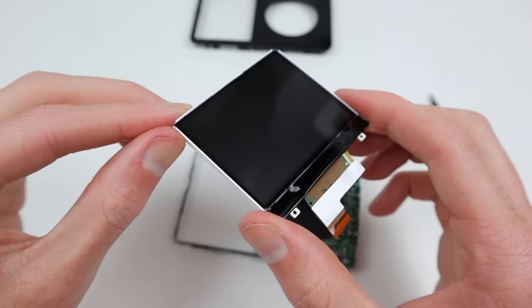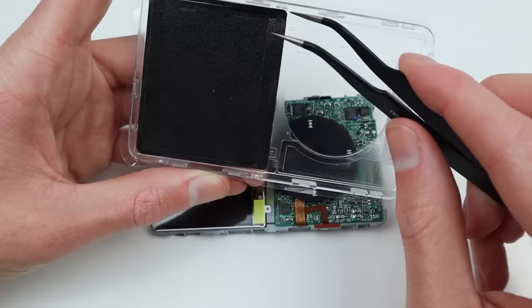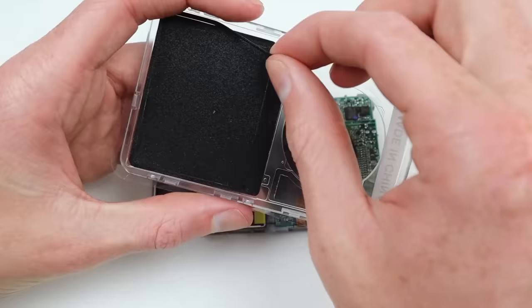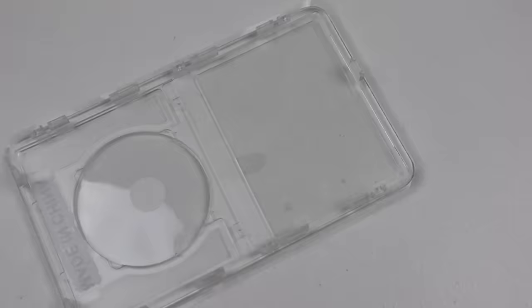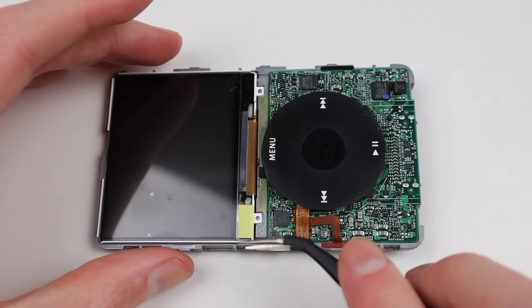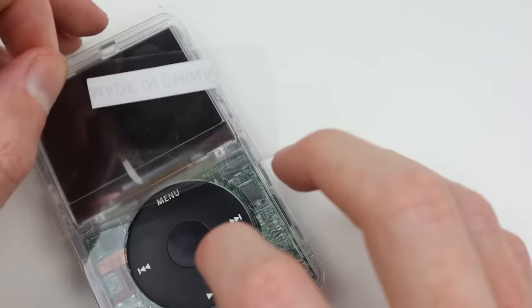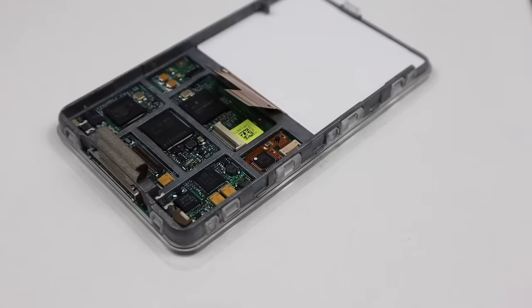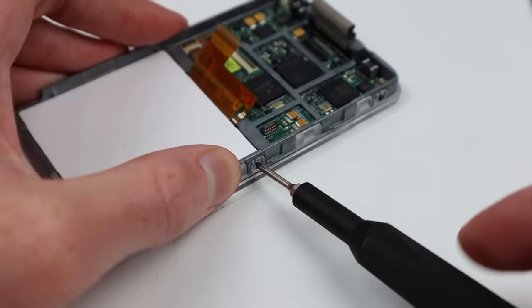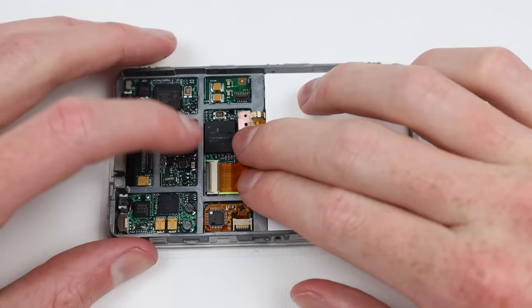I'm a big fan of custom devices, so I thought it's about time I customized one of these old iPod Classics — one of the best tech devices of the early 2000s. I've removed the faulty LCD display and can now prep everything for the new transparent housing. I'll install a new display purchased for around $20 off AliExpress — likely off a used iPod, though I can't confirm that. I need to remove the protective film off the new faceplate and clean all the adhesive residue left behind, so there are no specks of dust between the two halves.